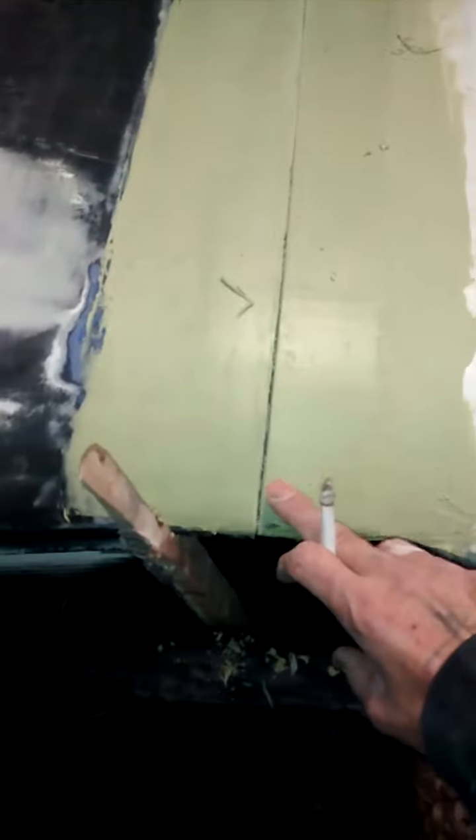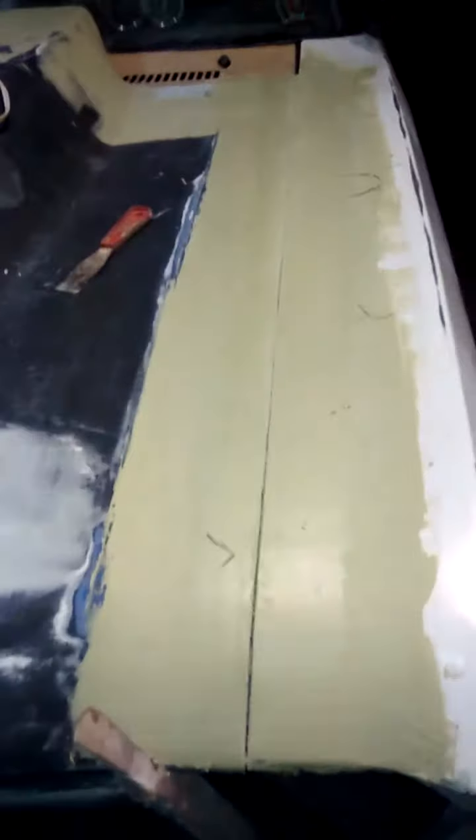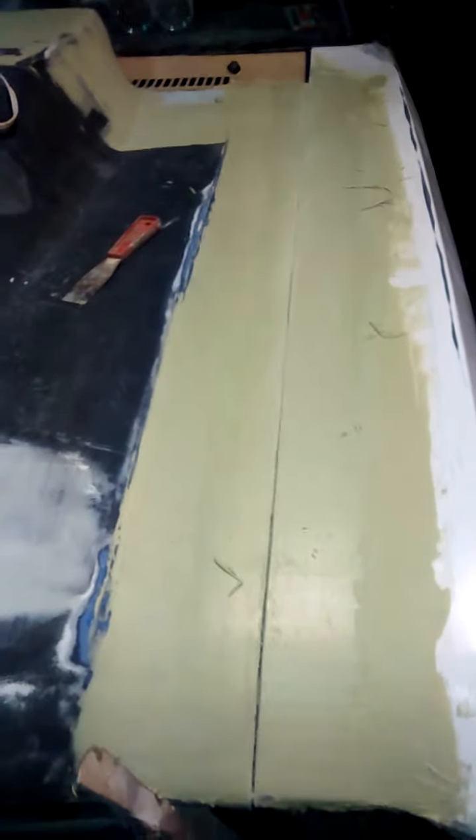Then I had to give the front of the hood some arch — it was pushed in. Here I cut it, heated it up, and pulled it down because it was in on an angle, and this area was way down about half an inch or so. I sliced it inside, heated it here, pulled it up, and then same thing on the other side. Bondoed it all in — glassed everything first — and then this is just a very light coat of lightweight mud, with little strips I cut out.